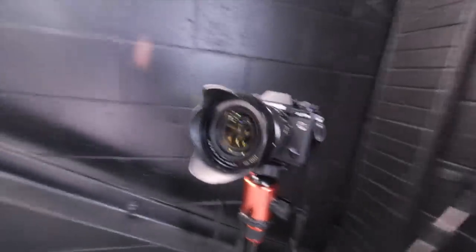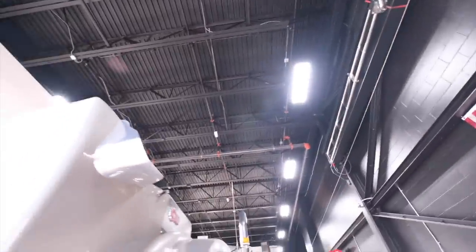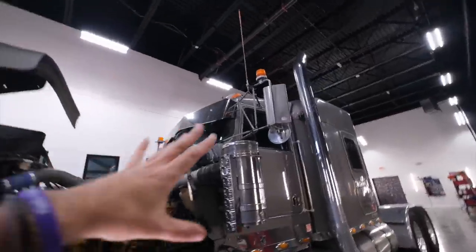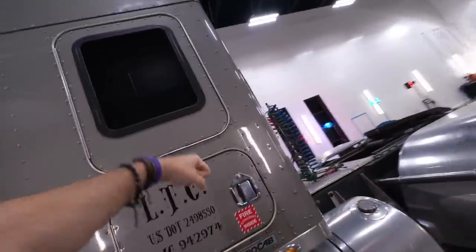So we've got camera number two over here looking this way. Squeeze trigger I'm going to use here. Got my fancy tactical light on there so I can see real good, and that's hooked up to my ceiling boom. That thing's going to swivel out, get centered over the truck here, and then that boom will swivel from there. This is going to allow me to go in one pass all the way around and not stop at all, not washing sections, nothing. I'm washing out of direct sunlight, so I don't have to worry about it drying.